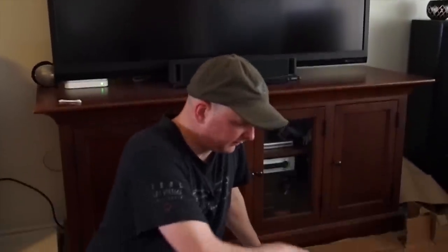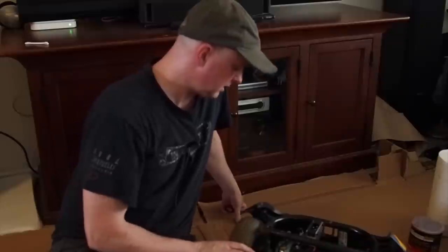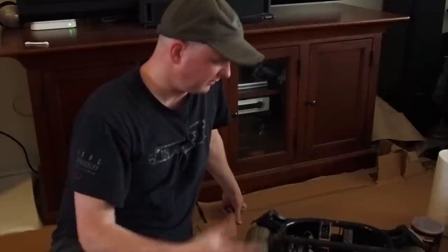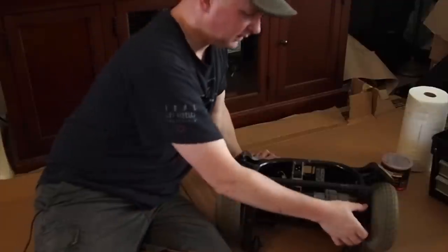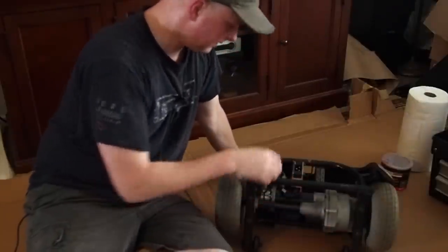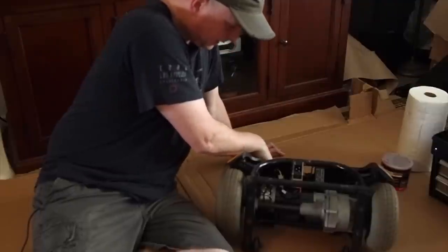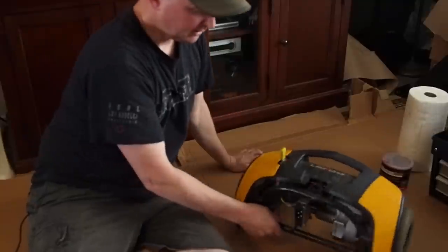We're back. We're going to take apart this rear part of the mobility scooter — it is the GOGO Elite. It's not terribly complicated in terms of mechanical things, it's pretty simple. There are these four big screws that hold the transaxle onto the frame, and that's it in terms of what's being held onto the frame. There are a few wires that need to be disconnected, and last of all there is this clutch lever here that allows the thing to roll.